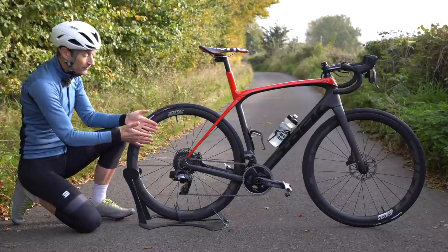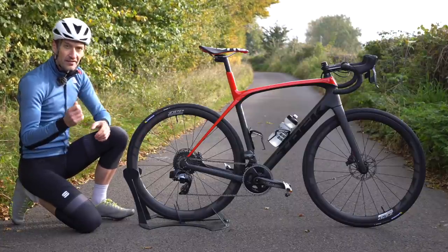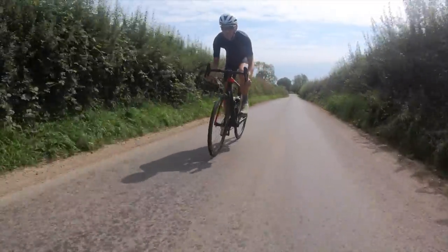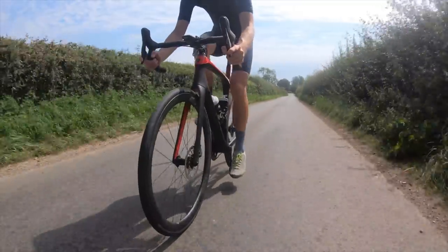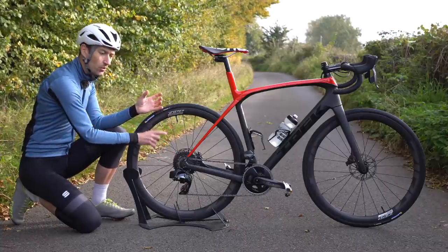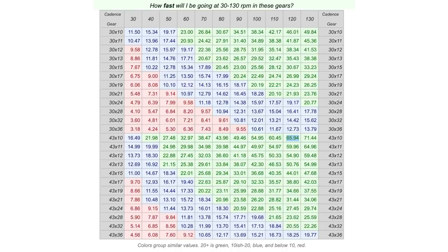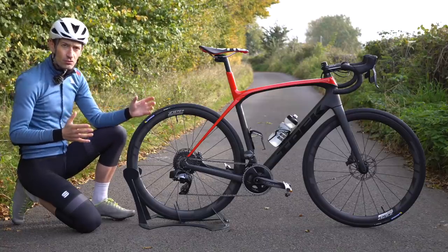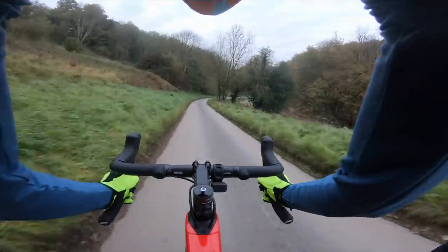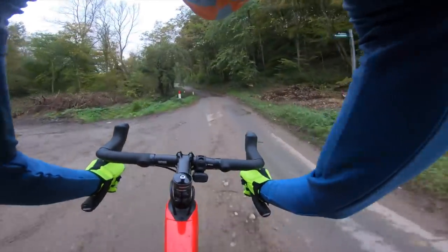What this groupset offers is low gears and wider range. Compared to Shimano's GRX gravel groupset, the big sprockets let you really spin and crawl up the steepest climbs — those climbs where on a normal bike you're just grinding and feeling the agony through your muscles. With this groupset I was able to get up climbs where previously I really struggled. And then there's much wider range than an 11-32 or 11-34 cassette. When you're at the business end near that 10-tooth sprocket, the first four sprockets have one-tooth increments for smooth cadence transitions.